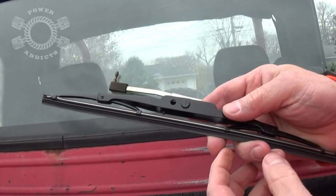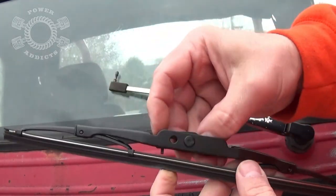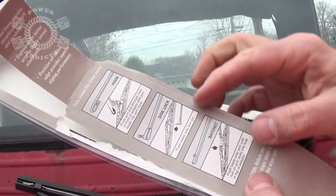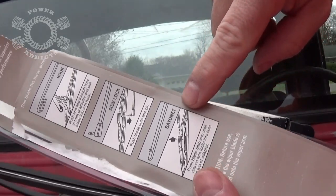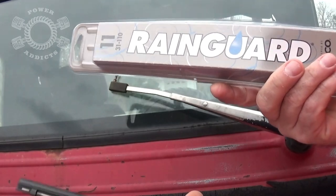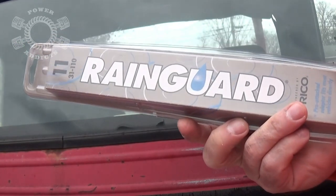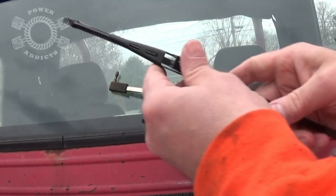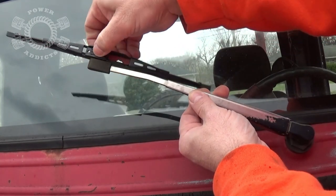Now let's get the new one ready. Take your new wiper out of the pack. Some of them are going to have different adapters, and what you want is the adapter that's going to be locking onto the post. This particular one will work with the hook style, the side lock — which is what this is — or the bayonet style. This is Rangard brand that I got from O'Reilly's. It's an 11-inch, part number 31-110, engineered by Trico. Simply slide it back over this right here, a little gentle push — boom — it's locked in.